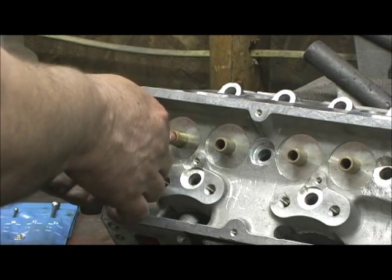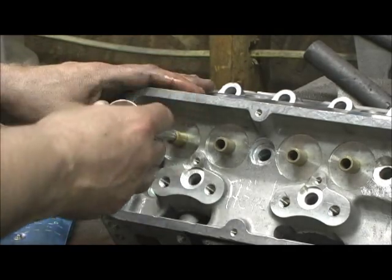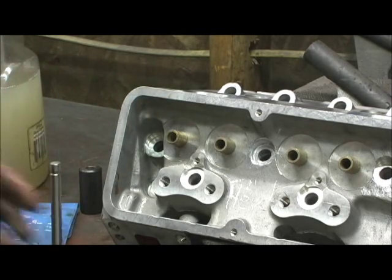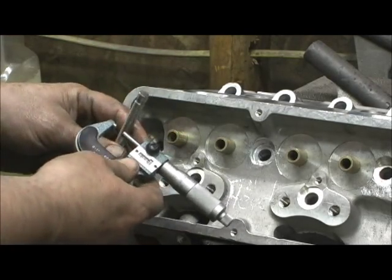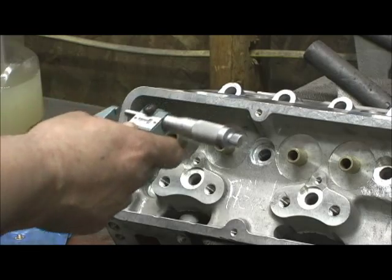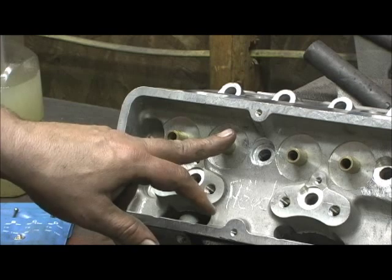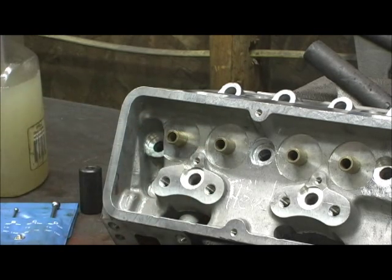That's the feel I like right there — that is just perfect. And I know that's going to give me one and a half thousandths. That's basically it: you get the measurement off the stem with a four-digit micrometer — I try to use the good ones. I'll add a thousandths and a half to 1.6 on the exhaust, and on the intakes I go to about 1.2 or .0012. Some of that clearance is also built into the valve itself. I'll go ahead and finish the guide work up, then we'll be ready to do the valve job.